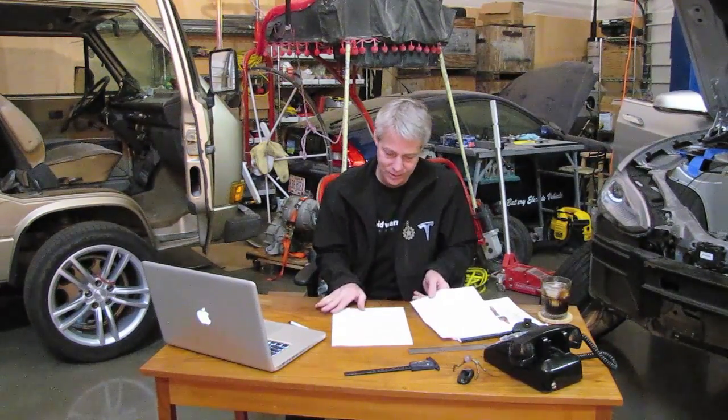The weight rating of the Tesla suspension and axle rating is actually higher than the Vanagon rating. I'll be exceeding it some, but I'd like to start with a higher number. The Tesla also has air suspension, and I've owned a car with air suspension before and I really like it — the Smart Air Suspension. Really smooth ride, it adjusts heights and remembers where you were using a high height and goes back to it. My last car with air suspension on washboard dirt roads gave such a smooth ride. Since this will see occasional washboard dirt roads, sometimes for a couple hours at a time, I think that's worth quite a bit.